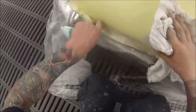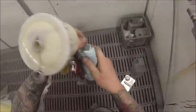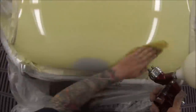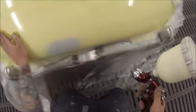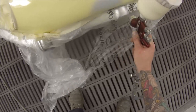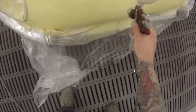Next up here I'm wiping it down with a wax and grease removing solvent on a wipe-on rag and also a wipe-off rag. Make sure it's wiped off correctly or else you'll be left with a bit of a film in between your paintwork and the panel and the previous paintwork. Just plugging my gun in here and giving it a good blow down with the air in the spray gun, and using a tack cloth as well. I've slowed it back down to single speed here in real time, and added the audio in so you can hear the spray gun.